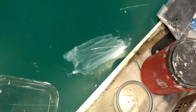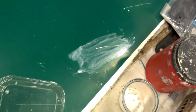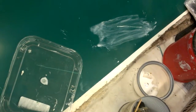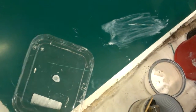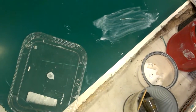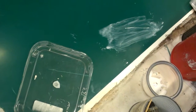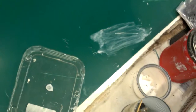In the handout, on one of the pages, Evercoat has a chart where you start, and where you can bridge off to different colors and what to add back and forth, if you really want to get into this frame of mind. What we did for my boat is I had Scotty Laurie, who has an excellent eye, mix up half a quart of gel coat to my color, because it was a Swedish boat from 1986.